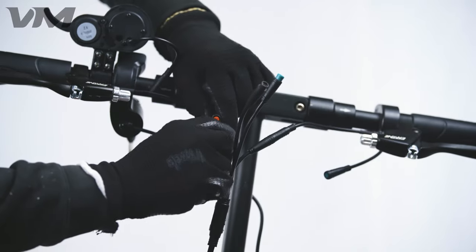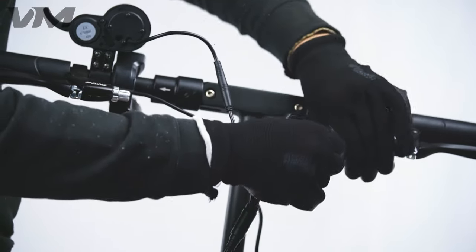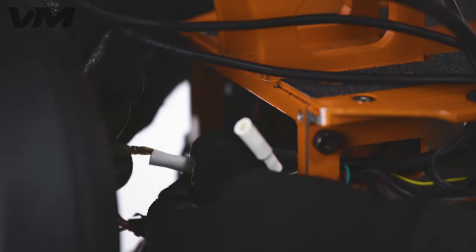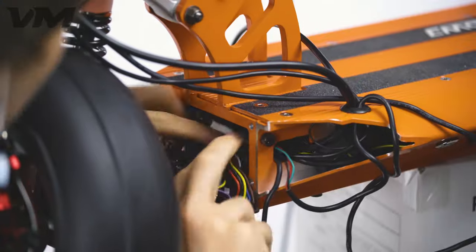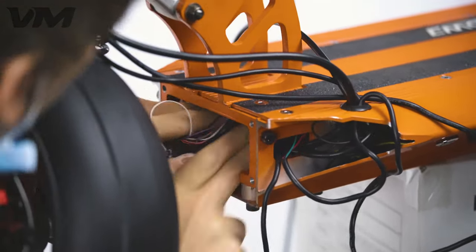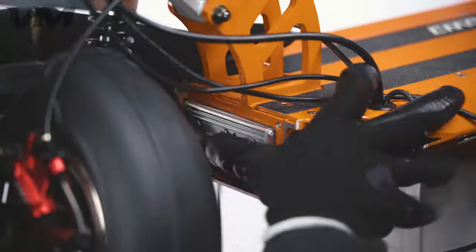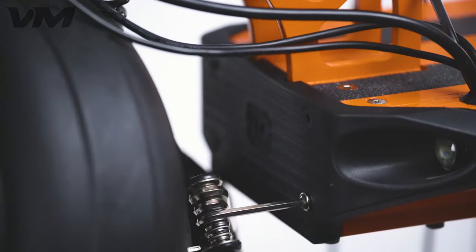Attach the four connectors at the top of the stem. With everything connected, you can restore power. Reconnect the black and red lines in the cavity — there will be a spark, but don't be alarmed, this is normal. Start pushing all the cables back inside. Once everything seems pushed in, place the controller back in. Once secured, guide the cover back in and screw on the front four screws and the two side screws.